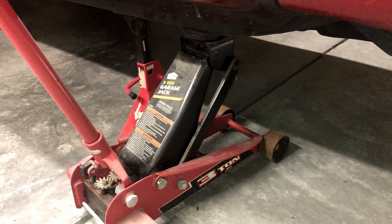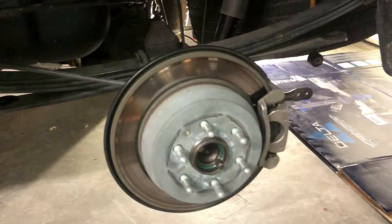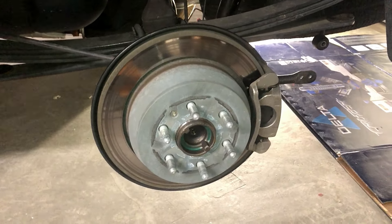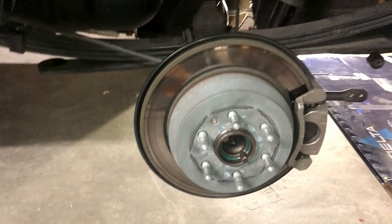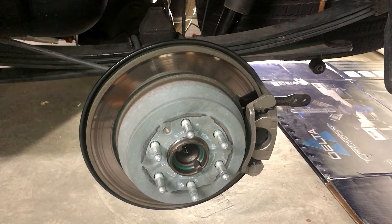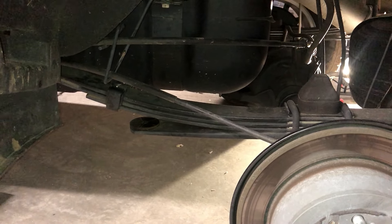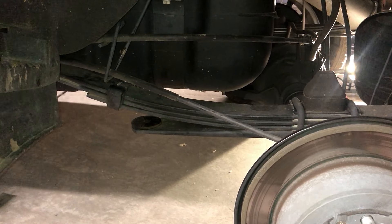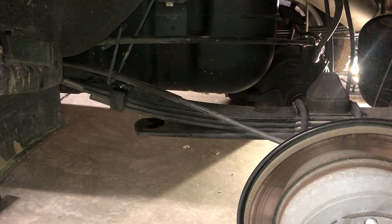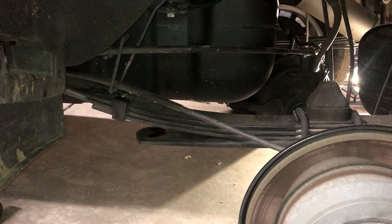So as you can see, I got the vehicle jacked up and jack-stood for safety, the parking brake is engaged, and I got the rear wheel off. You don't necessarily have to remove the wheel to do this, but I thought it would be easier for video purposes and to get more access. The leaf pack on the Canyon and Colorado comprises four sets of leaves — a bottom overload spring and then a leaf pack of three going up. Silverados and Sierras are very similar and this will work out pretty much the same way.